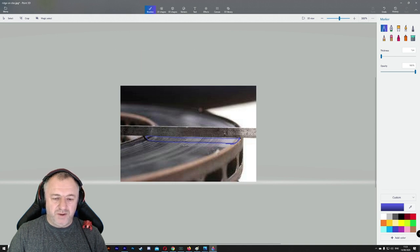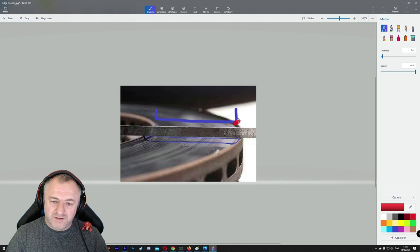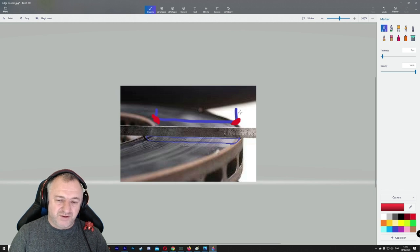So if you're going to put a brand new pad in, the brake pad is going to be square like this, so you're going to have to do what we call chamfering. You're going to have to make the pad go in a bit. Though we don't recommend it, if it looks this bad, you're going to have to take a bit of the brake pad off, like that, and a portion off there. And that's called chamfering. We chamfer it at, you could say, about a 45 degree angle. So it almost forms the same shape as this and fits in there, and then you can fit the brake pads.